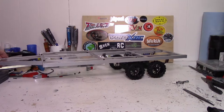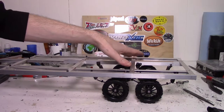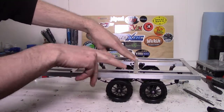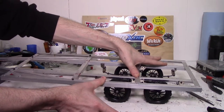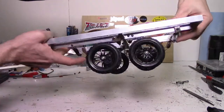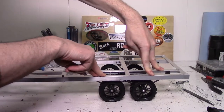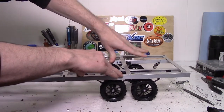There are a bunch of other things I still need to do with this. One thing I did realize that I think is pretty nice is — right now the suspension is decently hard, you've got to compress it fairly hard to get the wheels to come up enough to hit where the bed will be. I was thinking though, what if I have something even heavier where the wheels just come up way too high? Well, I can actually really easily lock out these leaf springs — all I have to do is push the shackles up like that and the leaf springs get locked into place and they become much, much more stiff, as you can see here compared to the other side.